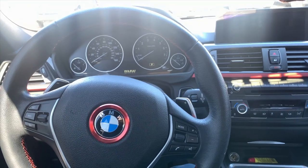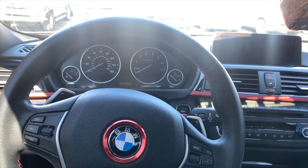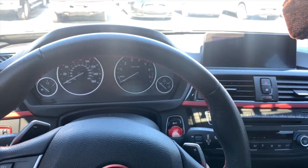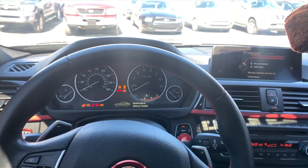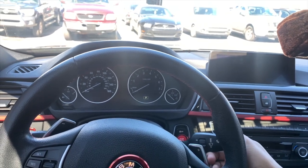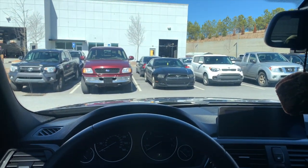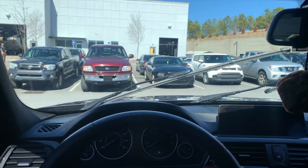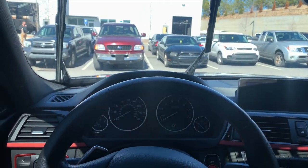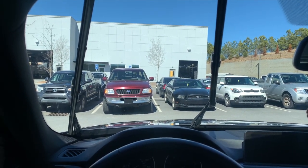So we're inside the car. There's a quick procedure recommended when changing the wiper blades. You've got your start-stop button right here — push it once, then turn it off. Then put your foot on the brake, take the windshield wiper lever, hold it up — keep holding it up — and then the wipers will stop. Let go of the lever, and now it gives you access to the windshield wipers. Let's head back outside and get them changed out.